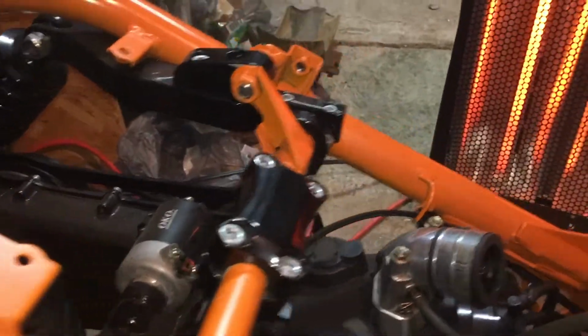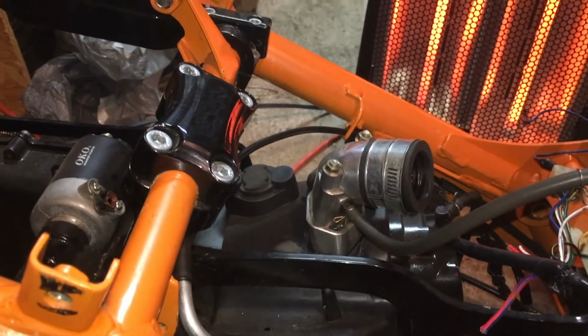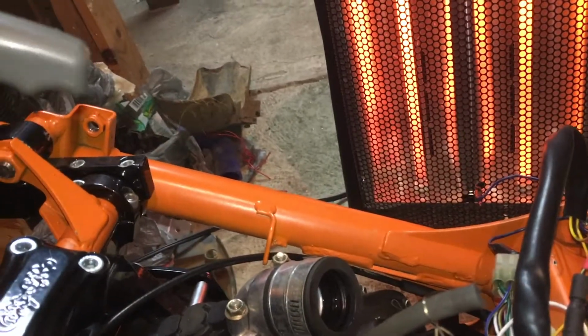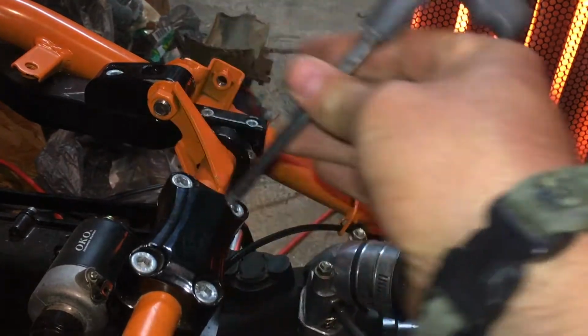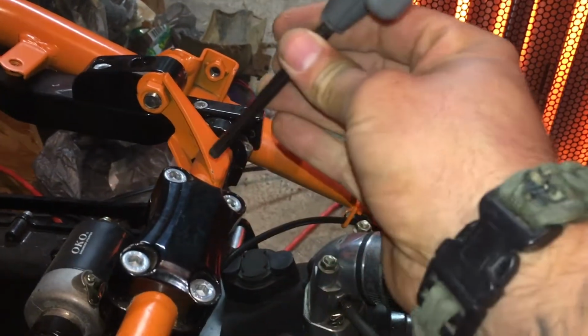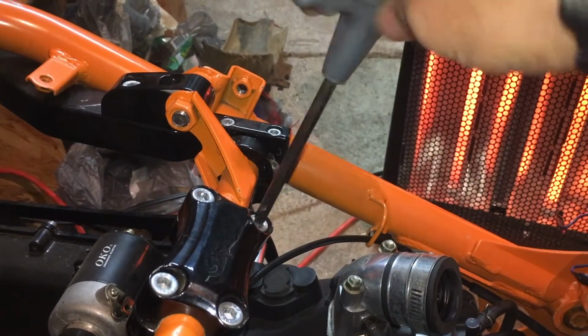Also, just so you guys know, which most of you probably do, I got lazy and was pretty much gas and go on this damn thing. I checked my oil and stuff like that, but I wasn't tightening bolts. That's the wrong size. Let me get the right one here. This guy here. Yep, third time's a charm. I've got my stuff laying out everywhere. I didn't break these loose or anything, but this is how loose my mount bolts were. I used blue Loctite on them, but obviously the blue wasn't good enough. So next time it's going to be red, because every one of these bolts is just stupid loose.